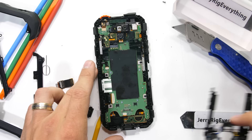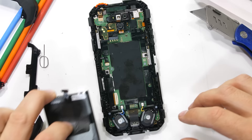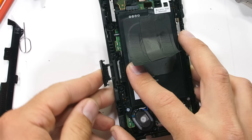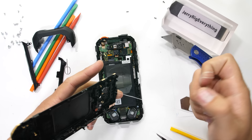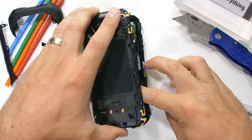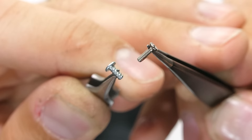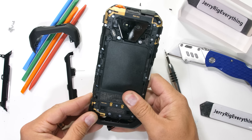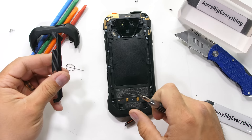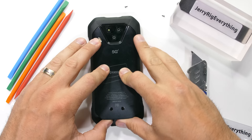The repairability isn't that bad either — everything is just held in place by screws, like it was back in the good old days before heat guns were required. Since mine has been taken apart, I wouldn't consider it waterproof anymore, and I'll probably never get this sticky gasket back into its correct location. One last tidbit: most phones have super fine threads on their tiny screws, but Kyocera is using very aggressive coarse thread. This allows more plastic to sit between the threads and gives less probability of the tiny screw stripping out of its hole. With 30 screws using coarse thread, things are pretty well held together. With the body armor pieces back on, we can get the back plate situated and it's time to turn things on.